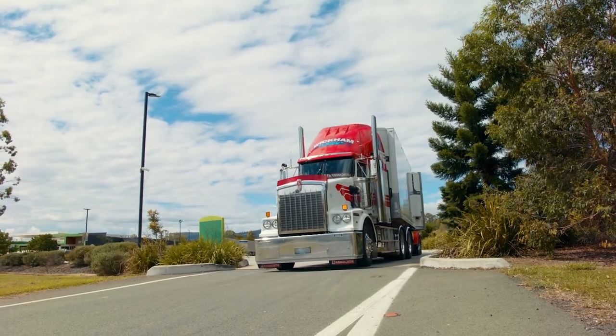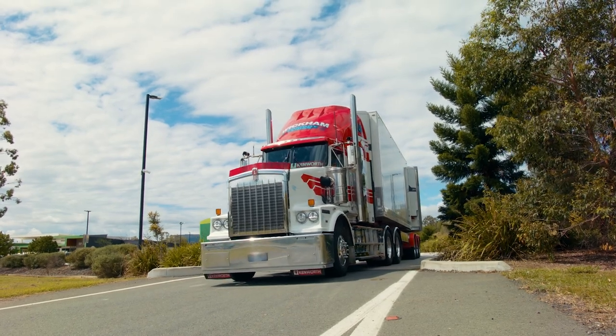The key thing is to be prepared before you get there - change down gears before you get there, having the power divider and diff locks engaged, and keeping your high RPM, using the horsepower rather than lugging the engine. That way you're not changing gears halfway up at that last pinch.